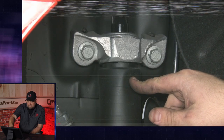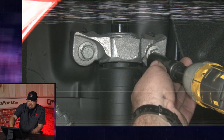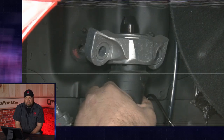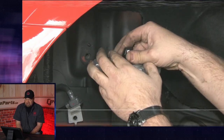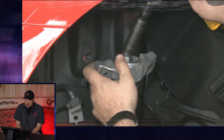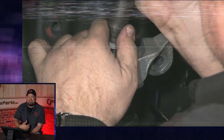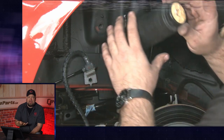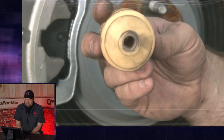The bump stop is inside the rear shock, so we have to replace that as part of the installation. As for how low it gets — at the time, we really didn't know. When we got these springs, they came in a white box with no instructions and no torque specs — nothing. This was so early in the S550 development that we didn't even know how low it was going to go. We were guessing an inch and a half to two inches, but we really didn't know. Here was the challenging part — definitely the rear suspension, because we didn't know how to do it. We could see where the spring was and how the subframe held it in place, but we kind of just guessed. I looked at the suspension, figured I could let it down and get it out, but we didn't know if we'd throw the cradle off or if there'd be enough room.